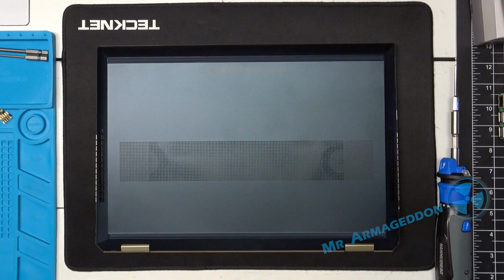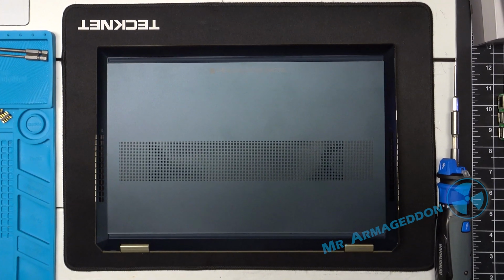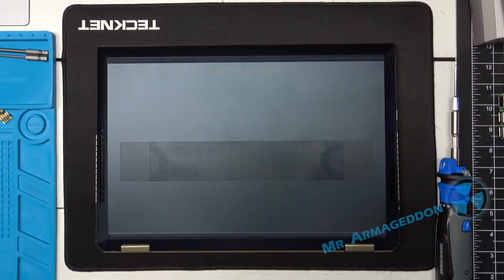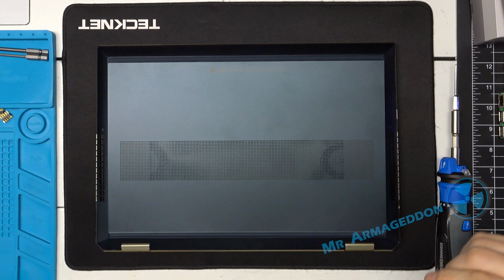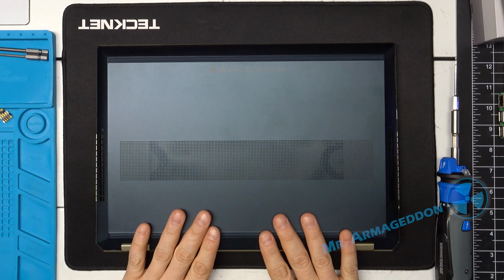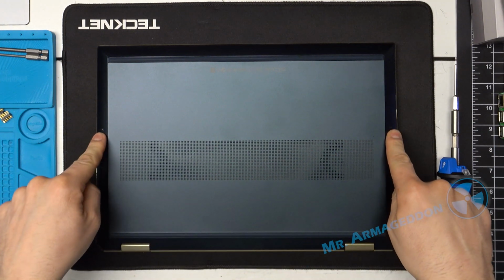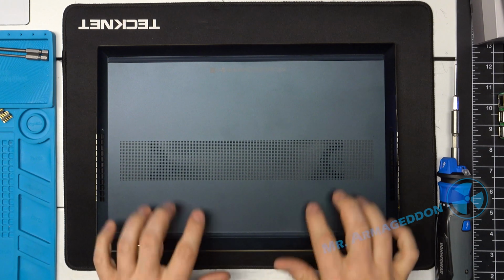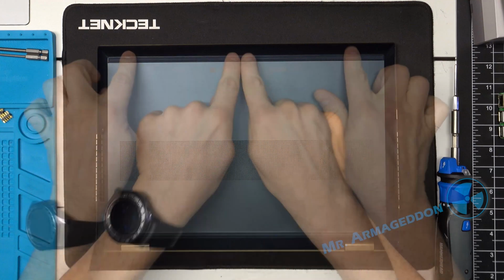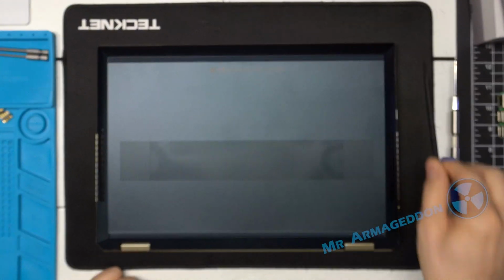Now it's time to take a look on the inside of the HP Spectre 15T. I'm going to replace the solid state drive with a new one. Alright, so in order to remove the cover on the newer Spectres, you only see 2 screws visible, but there's in fact a total of 8 screws. There are more located underneath these rubber feet that we have to remove from the bottom of the laptop. So doing so is pretty easy.